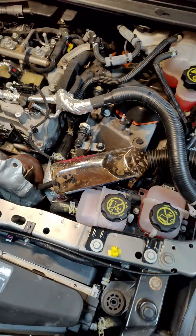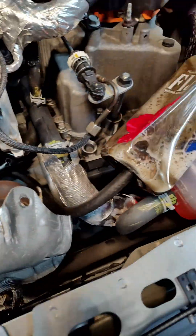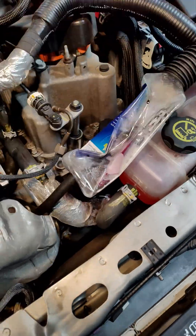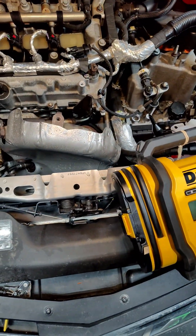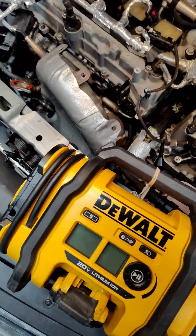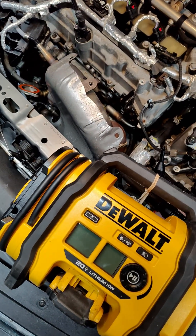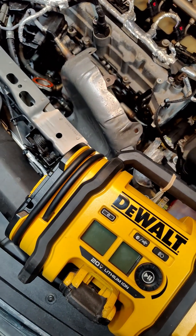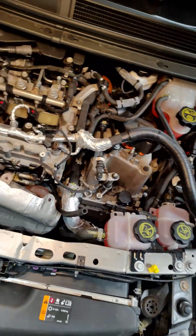It's kind of the equivalent of a smoker's lung after 60 years. I'm going to get this all cleaned up. I'll flush some water through the system and then get it buttoned back up. This is a handy tool, but if you have a compressor you can do the same thing — I was just back-feeding dry air essentially, just to make sure any residual moisture is out of the system.